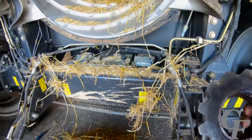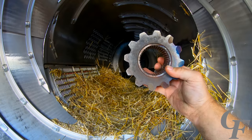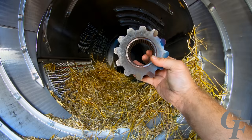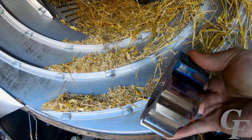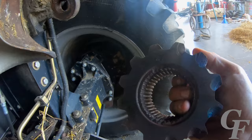This gear fits on the drive shaft coming out of the gearbox and got a big bolt and washer holding it on, and apparently the bolt either broke or worked its way loose, letting this slide forward off the shaft until it boogered up the splines there. I also got this thing hot and chipped off part of the teeth. All this is a big paperweight now.